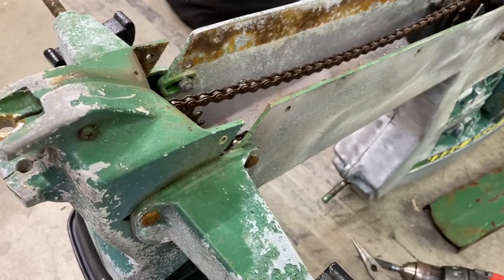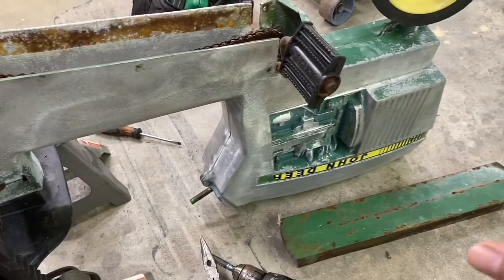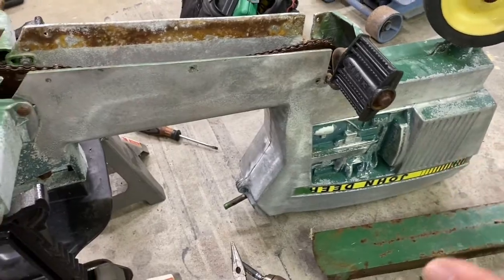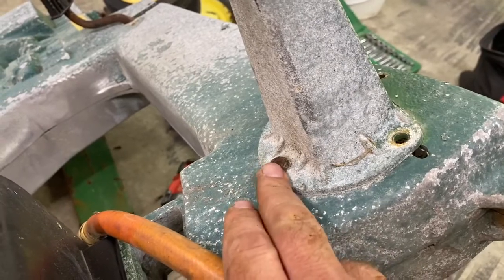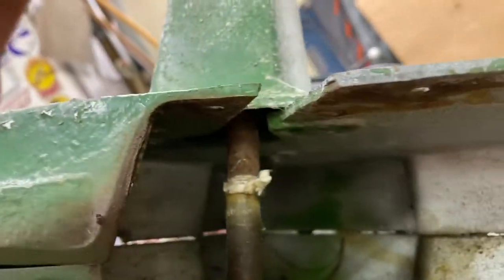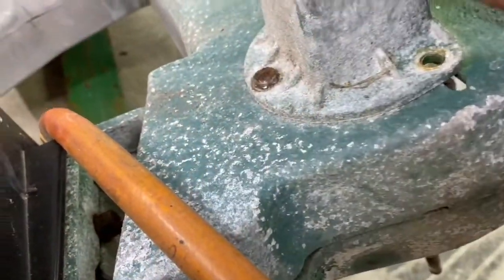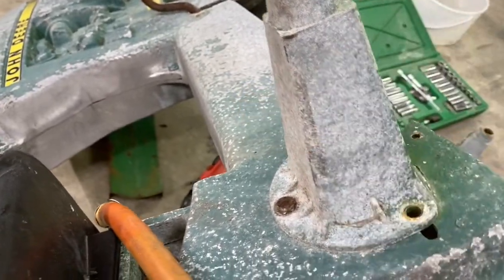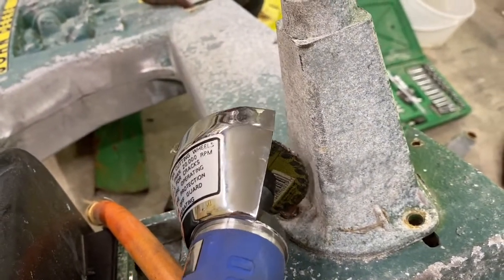Anyway, that's all you've missed. Right now I'm going to continue taking this stuff apart. This is not going to be like a show quality restoration - I'm just going to paint this up and the little kid is going to actually use it when we're done. I got the one axle extension off - there it is sitting right there - and typical, this is what happens: the hardest bolt to get to has stripped the head off and the other end of it's in there. You might be tempted to chisel or give it a smack, but this pot metal - it's brittle and it'll break.